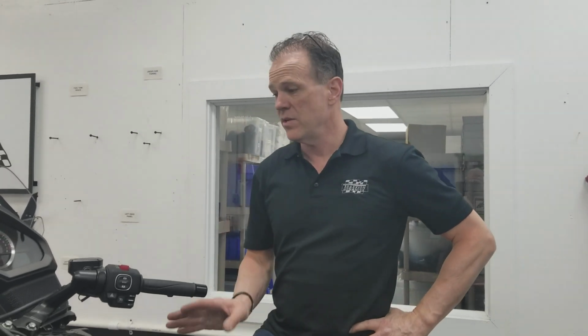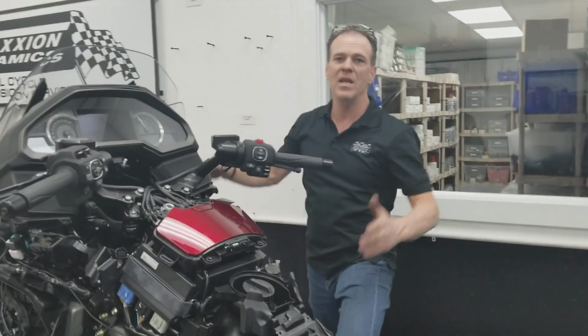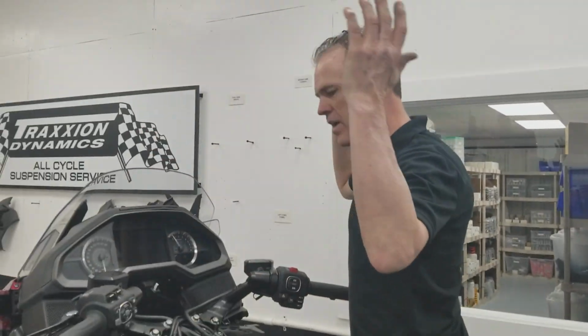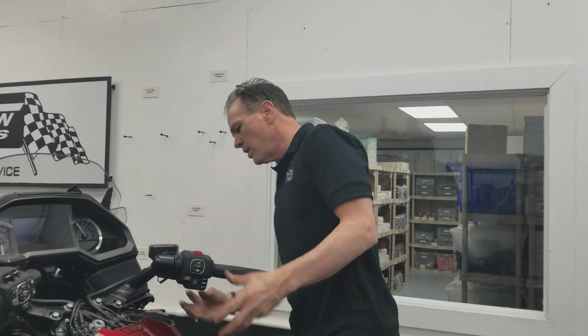So we wanted to check those bearings and make sure they were properly adjusted while we had it apart, having found the crown nut loose. And we couldn't figure out how we were going to do that. But it turns out that spindle is like a giant bolt. So there is a bolt head underneath up in the frame. Now, in the Honda service manual, believe it or not, the way they show it is everything you see has to come off the bike. And I mean everything. All of the fairing, gauges, instruments, electronics, the whole entire front suspension and everything to get to that bearing in there.